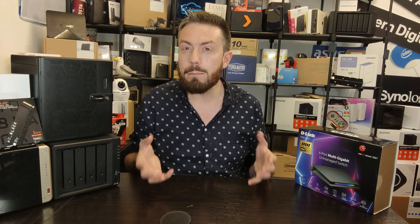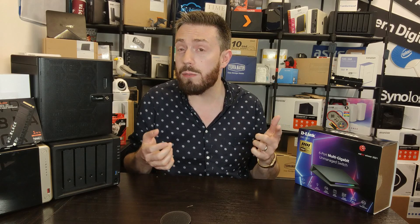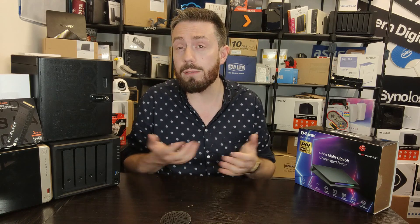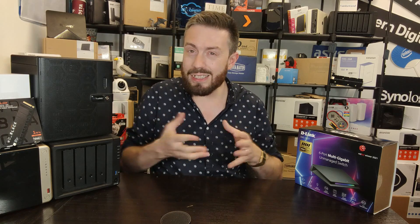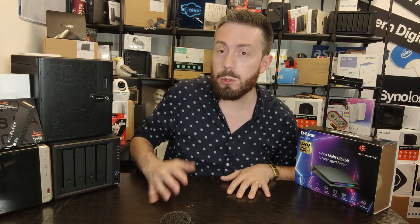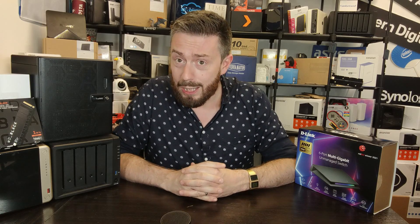If you're looking at 2.5 gigabit Ethernet switches, despite the fact that most NAS devices are starting to arrive with 2.5 gigabit Ethernet ports at the same price as 1GB ports, 2.5 gigabit Ethernet switches aren't sharing the same price parity. They knock around for 2.5 to sometimes even 3 or 4 times the price, due to rarity, newness in the industry, and the larger switching capacity needing better internal components. There's about 8 or 9 good contenders in the market — ones like the QNAP 1105T, a 5-port switch knocking around for about 80 to 100 pounds, and an Ace Storm model at a not dissimilar price. So you're going suddenly from 25 to 30 quid right up to 80 to 100 — a big jump.